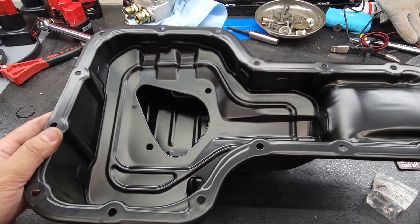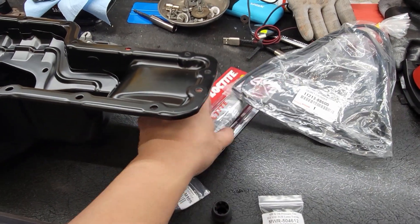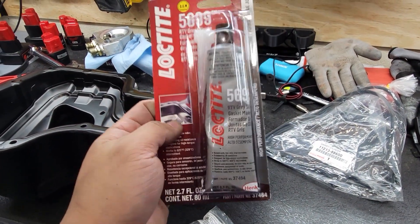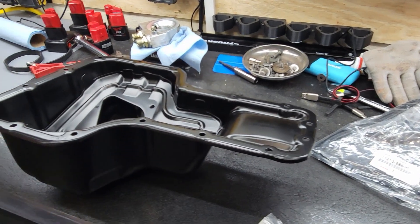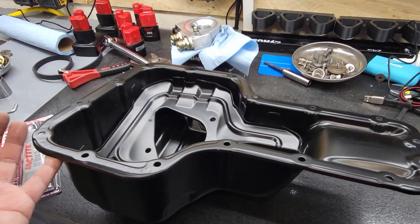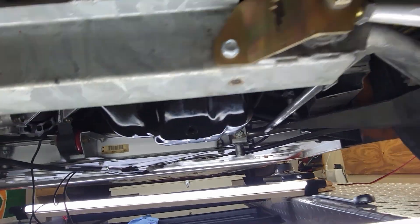It's similar to another website's pan — I believe it's elisparts.com — they say they use these in their racing car. Along with this I also bought the RTV that they sell on the site. I have not done an RTV-type gasket on these before; usually the oil pans I do have a traditional gasket.